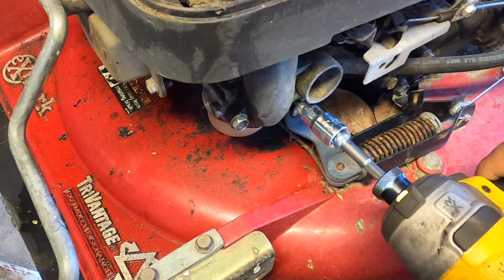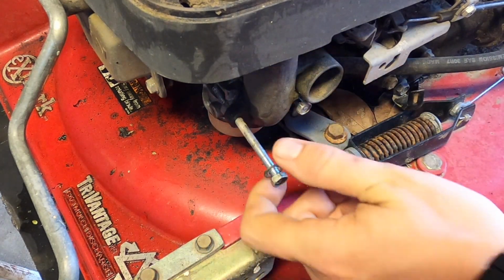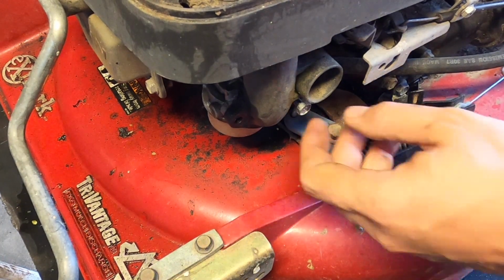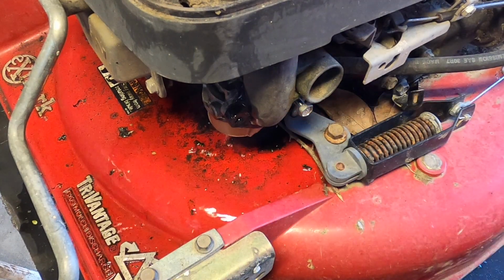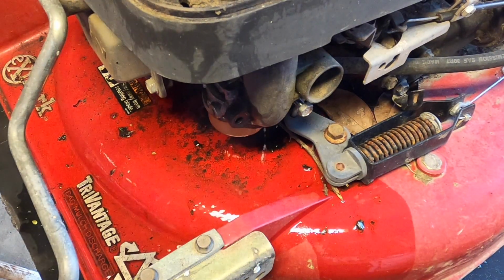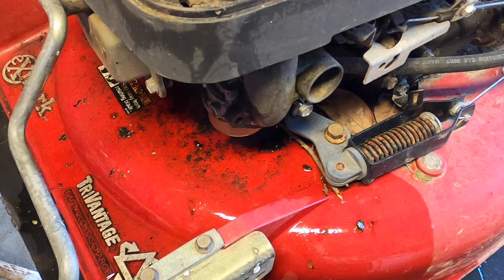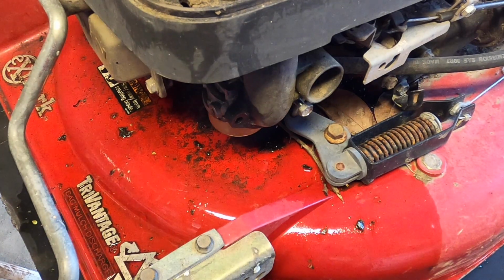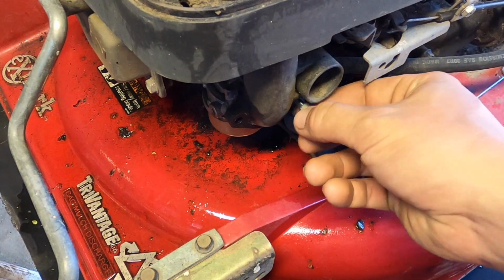I believe you can take this off and this just snaps into place. Definitely smells like gasoline in here, that's for sure, after the hydro locking problem. This kind of brings up an interesting safety thing I want to... Oh boy. I turned off that fuel too. It's just flowing out. Yeah, there was a hydro lock or a bad needle problem there.